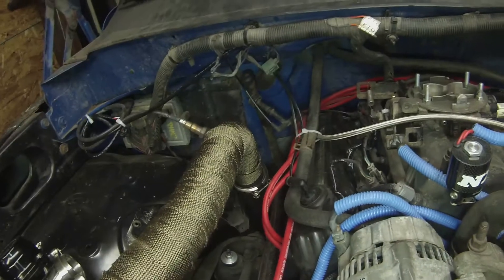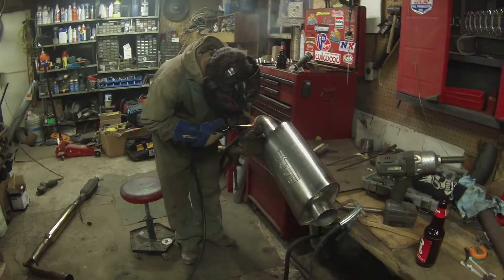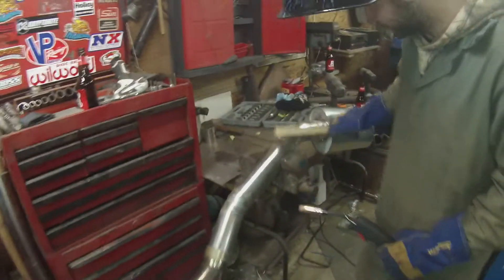Taking a break while Andrew welds. We've got the tip where we wanted it, we've got the muffler where we wanted it. All we have to do is connect the downpipe down there to the muffler beside the transmission and the exhaust is done. We've got the nice muffler here with the bracket on it, all these nice pie-cut angles to get it right where we want.